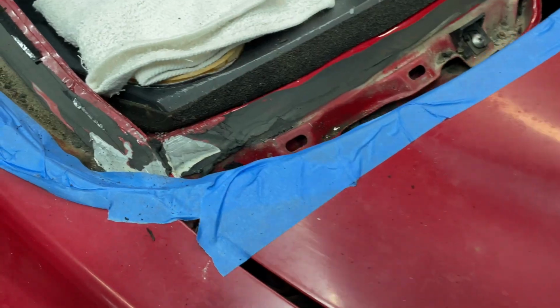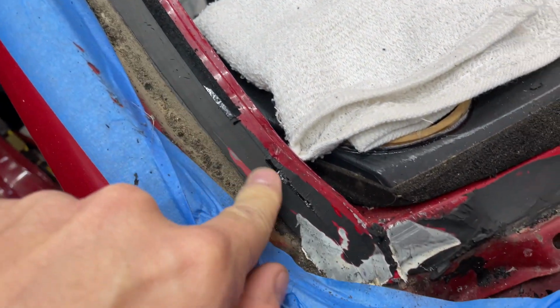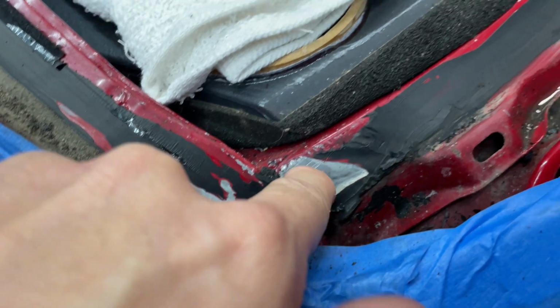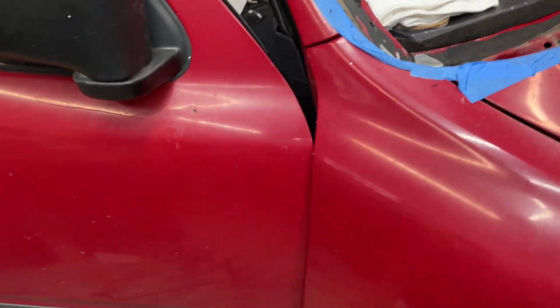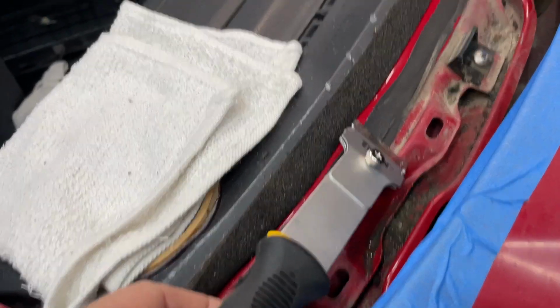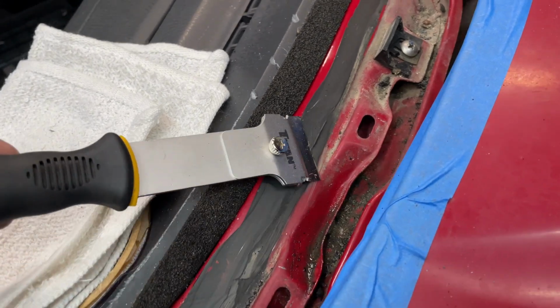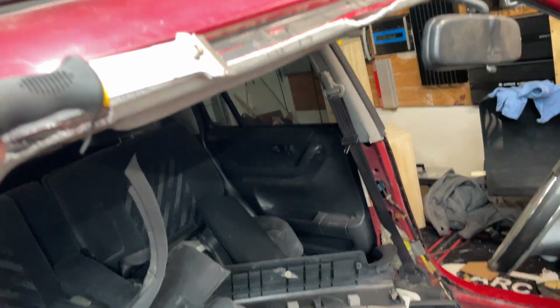We got to get this windshield back in, and getting the truck prepped has probably been the hardest part so far. I had to go back and scrape all the old urethane off, which doesn't sound like a big deal, but everywhere but the vertical runs, the razor is bigger than the gap, so I had to come at an angle, and up here I was getting all up on the headliner.